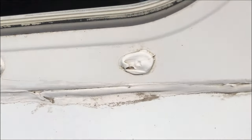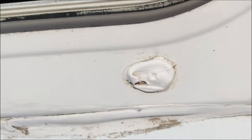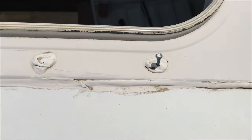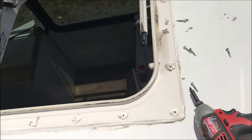How we get this emergency exit off the roof is we use the heat gun and just get the glue really hot, then put a little pressure and pry up in spots. It just gets the glue very thin and then it just comes apart — it works really good. Most of the screws are coming out pretty easily. You can see there's like a little bit of a square shape — that's the head of the screw — so I don't have to dig them all out. I thought this was going to take me 30 minutes and it's been about 2-3 minutes and I'm already over halfway done.